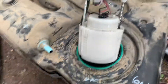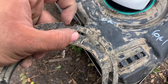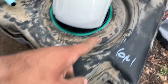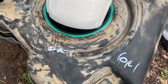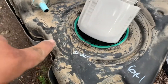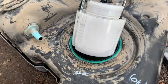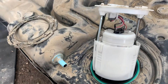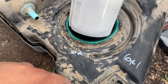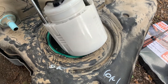Now I'm going to clean all the stuff off the outside of where the fuel pump is so we don't get dirt into the fuel tank. Then get a screwdriver and slide it over so you can get it into these slots to pull it off. The fuel pump is held down by this ring — you get a screwdriver and chisel it toward where the notches are so they can slide out. I used the vacuum to get the crumbled-up dirt that was going everywhere.